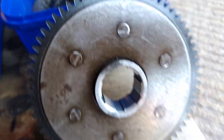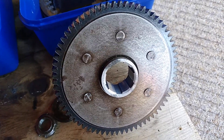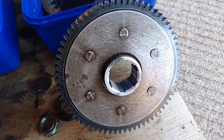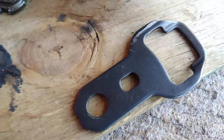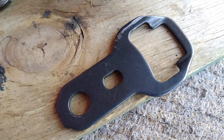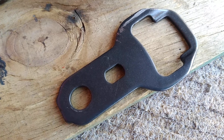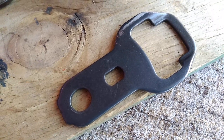The problem is I don't believe the clutch basket is in the wrong position — the sleeve and spacer and everything are in the right position, and I believe this is going back as far as it needs to go. I think the problem is that this shifter plate is too far forward, and I'm nervous about how the plate actually fits — it just seems sloppy and doesn't seem correct.